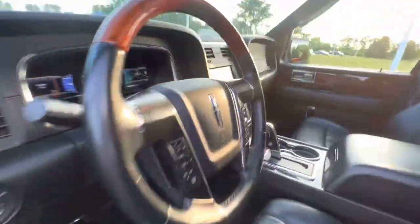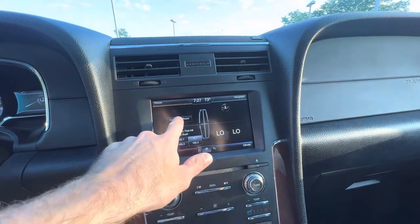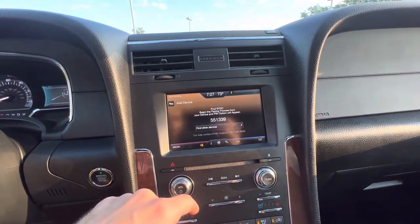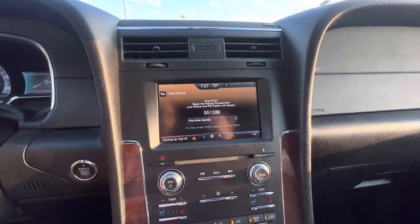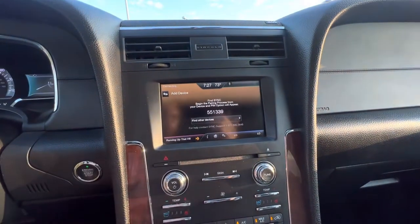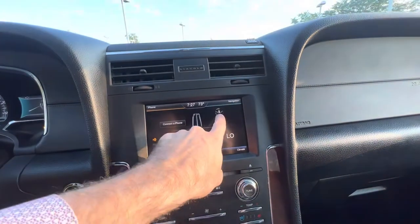Back up front — to connect your phone, you'll see either a 'searching for phone' or 'connect phone' option. Tap that and it will give you the option to add a device in the upper right-hand corner. On your device, select Sync. Once your phone's Bluetooth is on and discoverable, this vehicle will show up as 'Sync.' A number will be displayed on your phone — punch that in to confirm you want to connect that device.